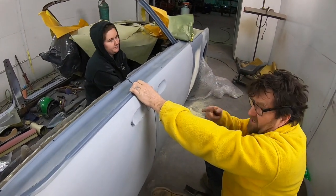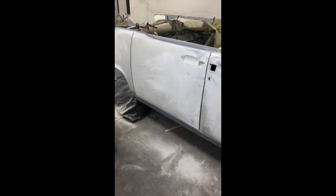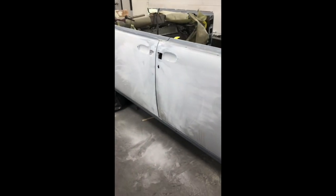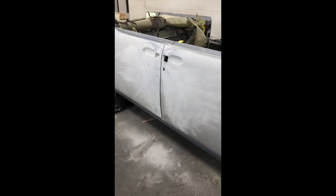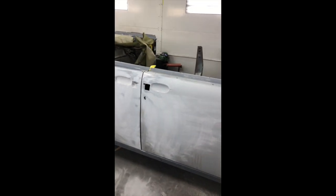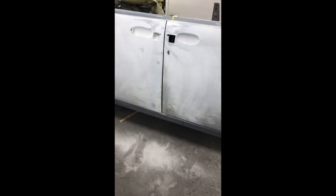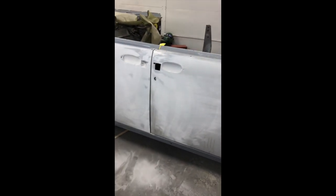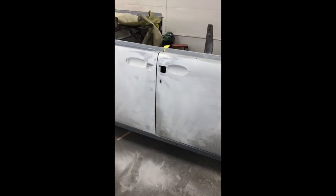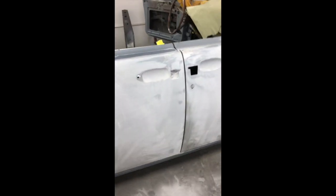Okay. The back bushings on this look good. We remounted all the passenger side door, doing everything with it, and just lining it up. It's been a bunch of time lining it up. The gap lines are real nice right now. The door shuts real nice. I'm gonna do some metal work right on that line right there a little bit, just dollying till the metal's really nice against one another.